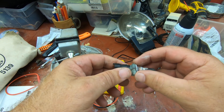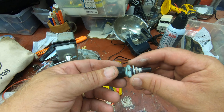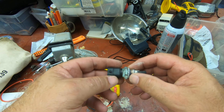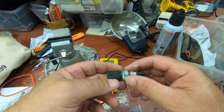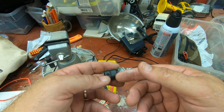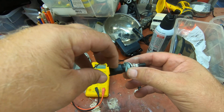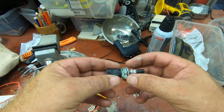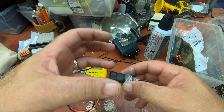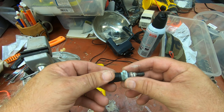We'll hook up my CanDo, which I'll show in a separate video, to check and clear the diagnostic code — because that's hopefully what's happening. Some people on the forums have said that when one of these sensors acts up, it'll throw a code, and the code will remain in memory even after the sensor starts acting properly again. I think the exhaust gas hitting this sensor messed things up and threw the fault. Now that I've got the exhaust rubber hose hooked back on to the exhaust box, I think we won't have the problem. We'll put this back on and see what happens.